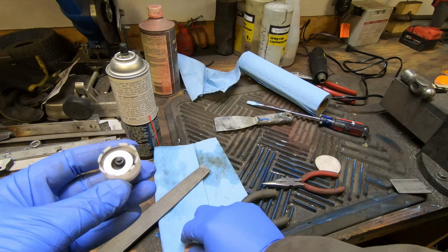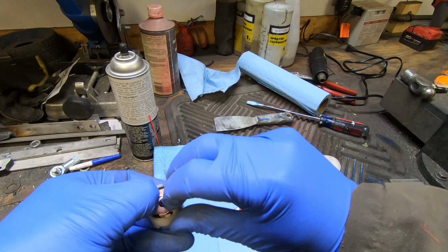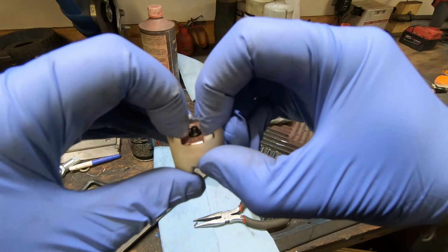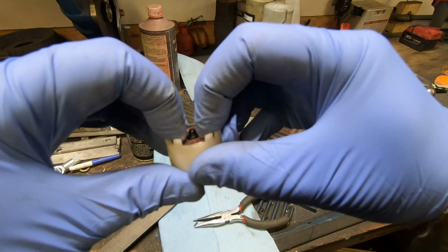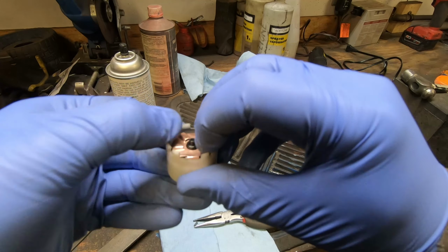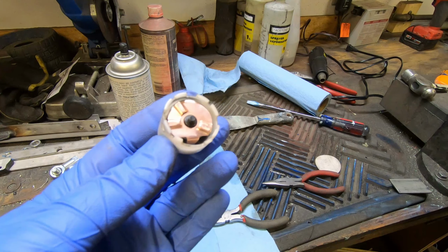pushing that disc forward. Because the way this works is, well, obviously there's a spring out right now, but that goes in there and then floats in there. And those springs are there so that when you go over the other part of the switch, when it makes contact, this kind of floats forward and back. So anyway, the goal is to increase that spring pressure. Make it all flat, put it back together, and see what happens.